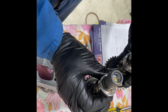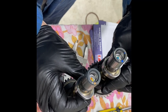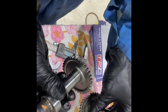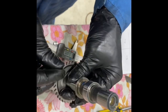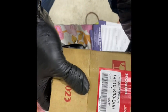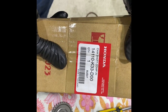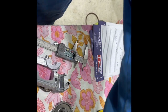You can actually physically see that in real life — the intake lobe of the CBR cam is visibly bigger. If you buy just the intake camshaft instead of buying both the intake and exhaust from the CBR, you will get the same outcome. So that's the part number you need to order — the CBR intake camshaft with that number. Don't worry about the exhaust because that's identical.